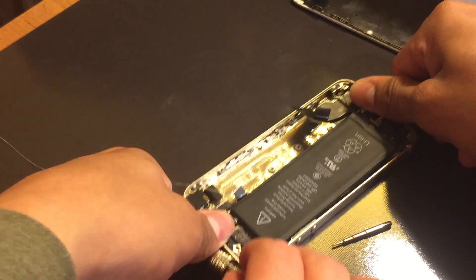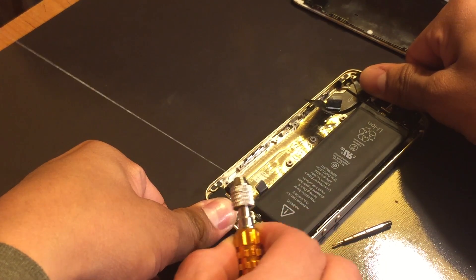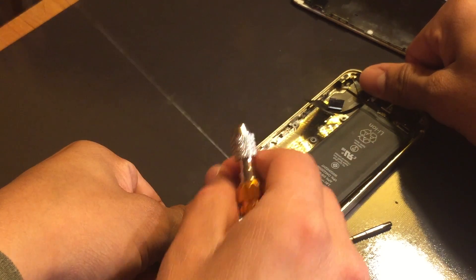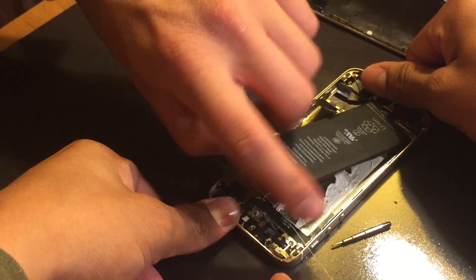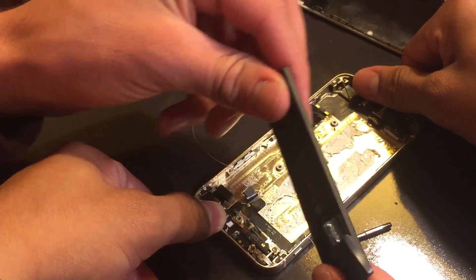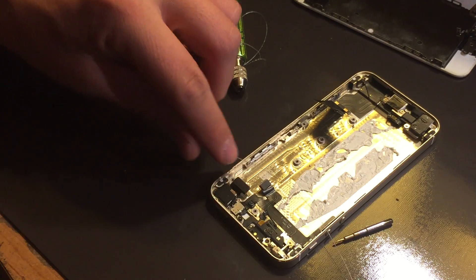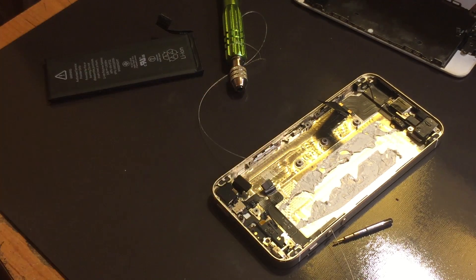As you can see here, we've nearly reached the tip of the battery. Now we're pushing the last corner — I'm going to go very slowly because there are a lot of small cables there. There it is — the battery is up, and it's fairly undamaged as opposed to having to stick something in there. As you can see, both glue strips were intact and we managed to run through both of them with the fishing line. At the upper end, this cable was a little bit hit by the fishing line but it should be fine. In the future, we're not going to run the cable so far up near the line — we'll probably stop about here and then put a card in.